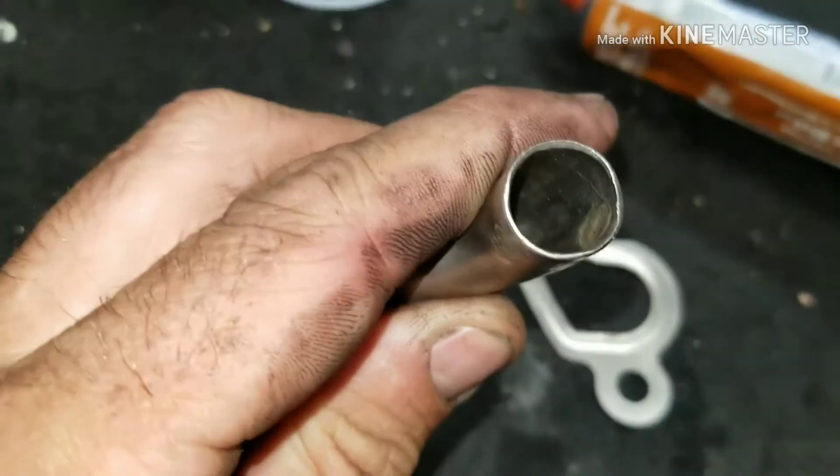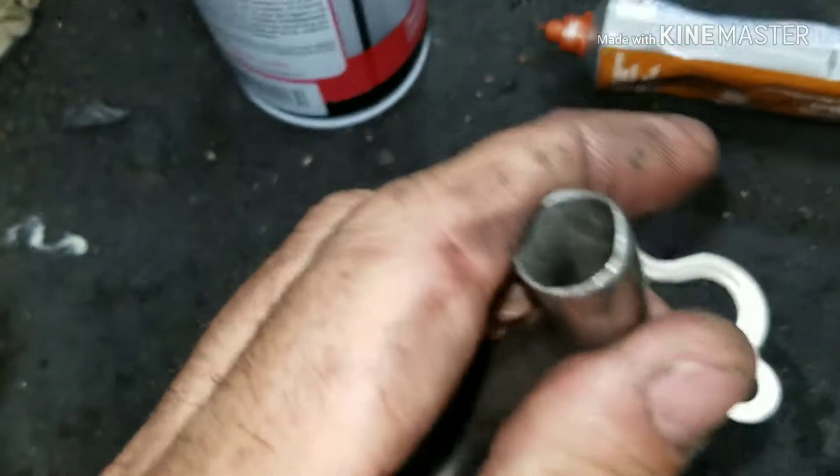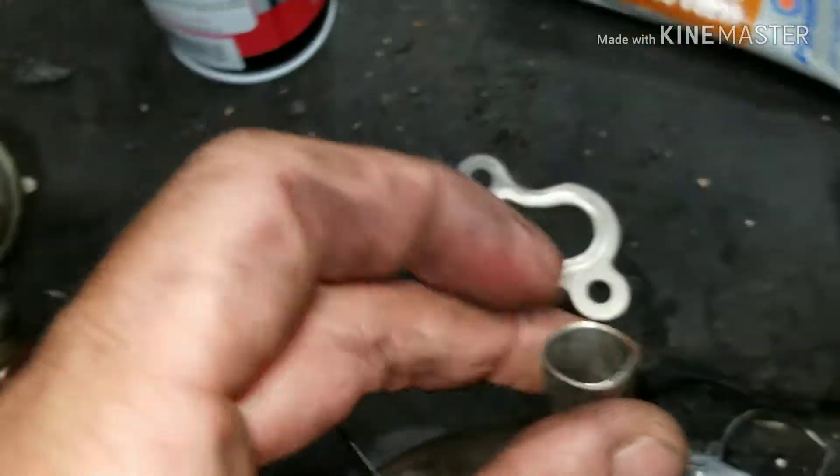This is what's keeping your engine from having the EGR operate properly. You got to go in here with like an old piece of speedo cable, put it in a drill or something like that. It'll spray a whole bunch of carb spray, cleaning it out. Disconnect it from your EGR tube and just clean it out because this is usually what's plugged up and gives you the code.